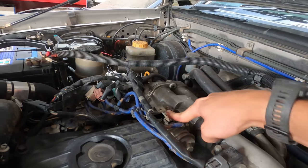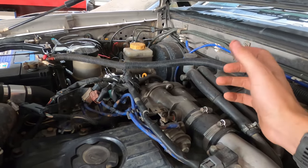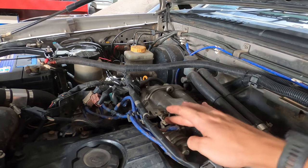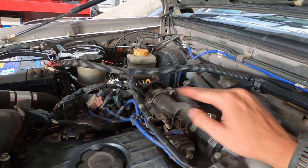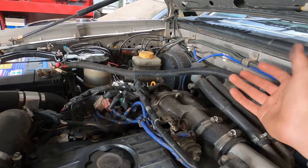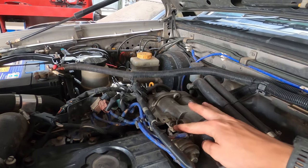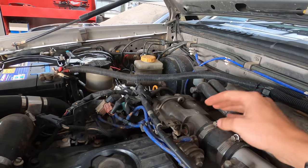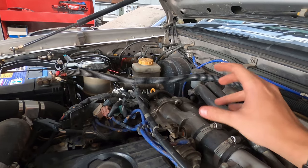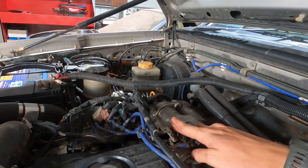It's not like the little EGR manifold up there that closes half — this closes the whole intake manifold and completely seals it like a little throttle body. In a petrol car you've got a throttle body; in diesel cars you don't. This valve is there, from what I can guess, to shut the engine off better — it closes when you turn the engine off, chokes the engine, then when there's no more vacuum it opens again. I don't think it actually functions any other time; I think it just stays completely open.